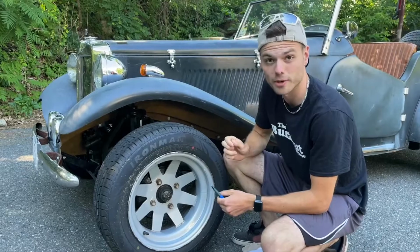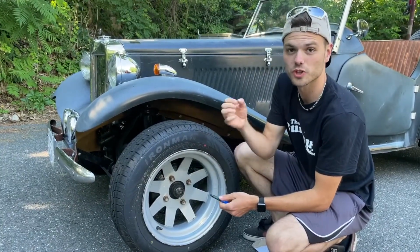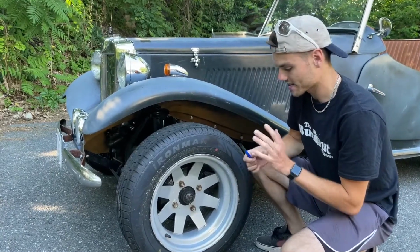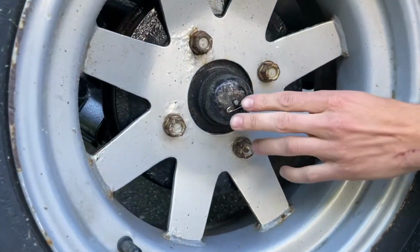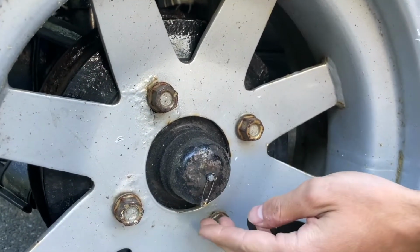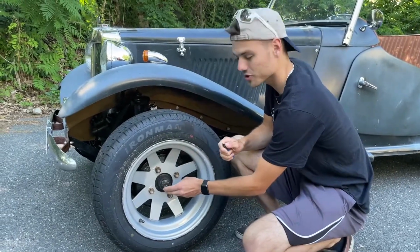And this is the speedometer cable. In Volkswagens, both the buses and the Super Beetles and Beetles, they all go back to the front left tire. That's where the speedometer attaches to the car to actually measure how fast you're going. It essentially sticks through the front left tire in a way that it just rotates. Now, as seen in the episode, you can see that there's a safety pin that holds this in. Normally you'd put an R hook right through this hole where the safety pin goes through. However, this piece is the speedometer cable that I'm pushing in right now, and it needs something to stop it from backing out and going through the tire. And naturally, we replaced it with a safety pin that would essentially do that trick.